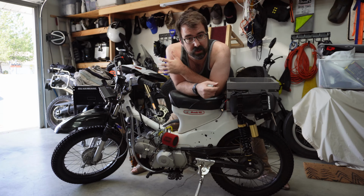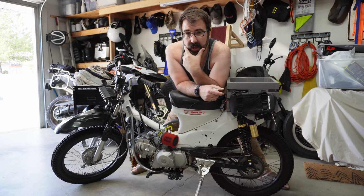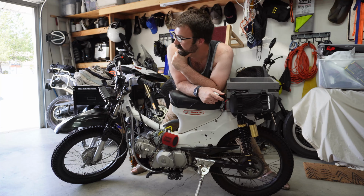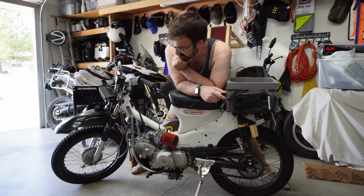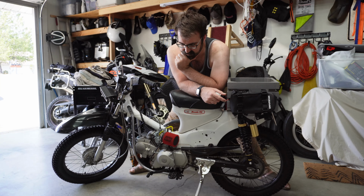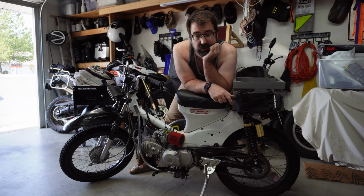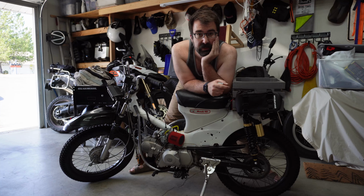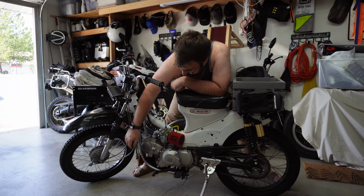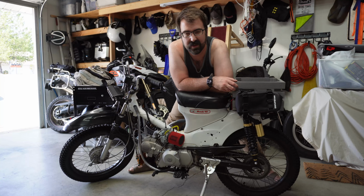Bought an oil cooler to put on it because the YX140 is kind of borderline on if you need one or not, and days like today where it's 93 or so, it gets screaming hot. The engine itself gets hot, the exhaust is right next to you, the whole thing just ends up being really, really warm. So I put that on, and it ended up leaking from everywhere that was possible. There's seams on either side, all of the fittings leaked, it was a mess.